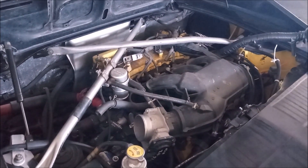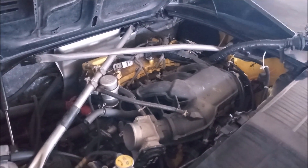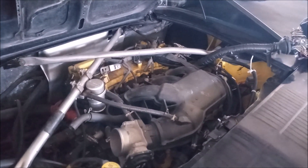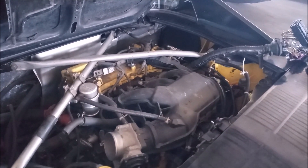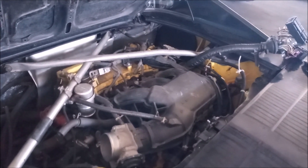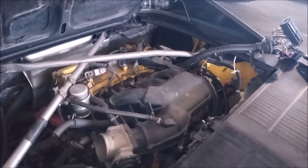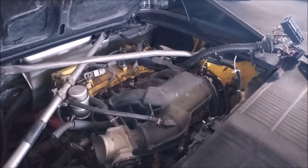So that covers it. I hope you find this video useful. Do pay attention to those harness grounds and engine grounds — they are very important. If you're missing them, or if there's a faulty wire or faulty attachment for the ground, it may be the cause of a lot of problems: check engine light, runnability problems, misfires, and false sensor readings.